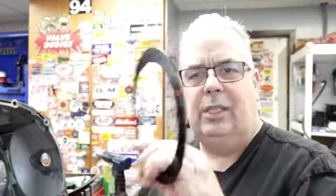I'll teach you guys something here. In the transmission world, this would be a single clutch, even though it's double-sided. In a torque converter, this would be considered a double clutch, even though it's one, because they count each side, since the factory clutches on all lockup converters come single-sided. So when the aftermarket companies put material on the front side and the back side, they call it a double. Then they'll add a steel, and take another clutch with material on only one side and add it and call it a triple, which really is 1.5, depending on how you look at it.